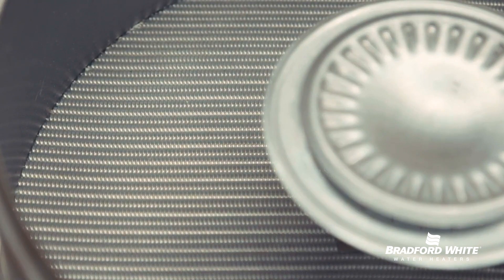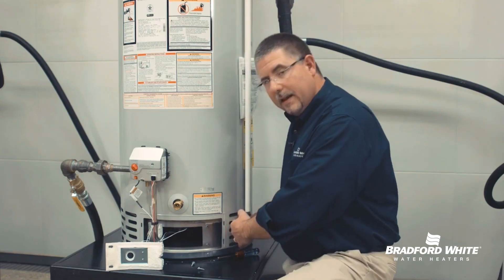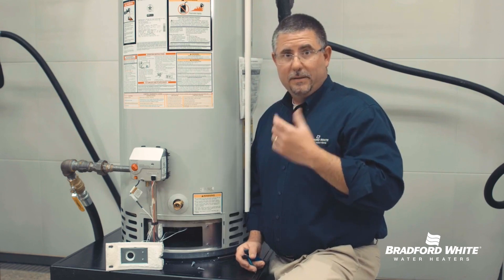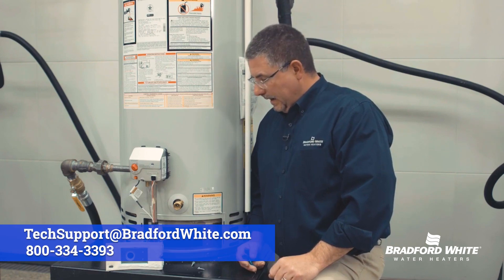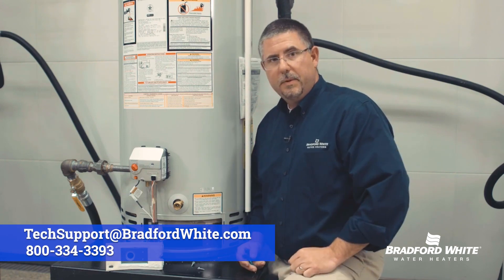Be mindful as you're blowing that compressed air in — out of the bottom louvers and even on the side, you're going to have lint, dirt, and dust flying out at you. So wear safety glasses, maybe a mask, and have a shop vac or some vacuum source to collect that debris as it's coming out at you. Clean it up, get it as clean as you can, button it back together, and you should be back in business.